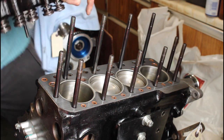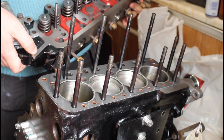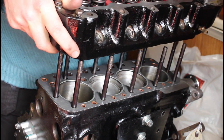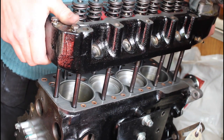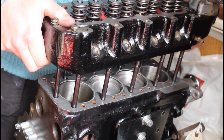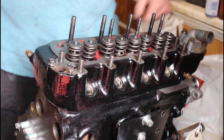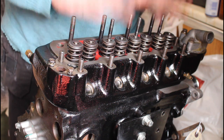Just pop the head gasket on and then the cylinder head next. It's a pretty normal big valve head, 28cc chambers — it's written on there. I think it's an Avon bar head. It's had a quick clean up and it took about an inch of paint off it to get it back to bare metal. There we go, just needed a wiggle. Next job: there's a stud missing out of there — got to find that — push rods, and then the rocker assembly.